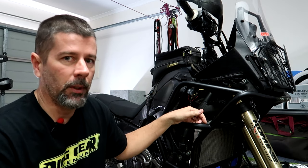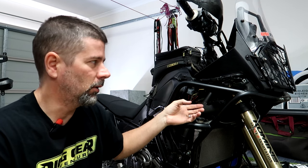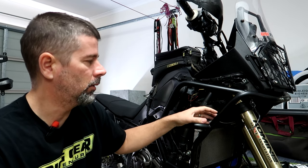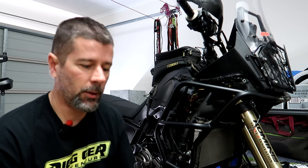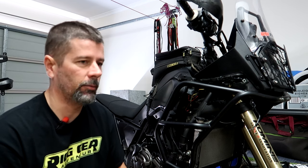A couple of other things to note: I know the designated auxiliary port for the fog lights is on the other side of the bike — you can use that one if you want, but if you're already using it for heated grips it shouldn't matter. I've done it this way because it's easier to access this yellow headlight trigger wire on this side of the bike. Also, you can still do this with a switch if you want — if you want to be able to run your high beams without the auxiliaries on, just put a switch on that yellow wire. Big shout-out and all the credit goes to that French guy — awesome work mate, thank you.